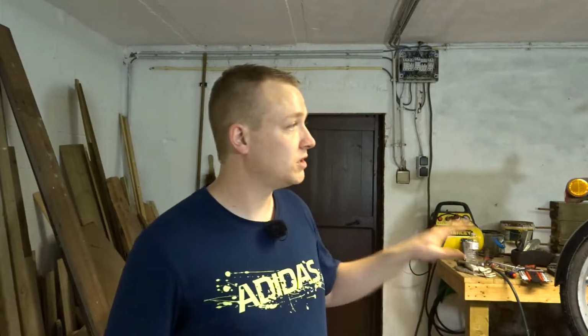I'm gonna have to order some jets. I'm thinking about going as low as 52 or 50 for 10 euro on JMPB parts. This is pretty good. I'm gonna do some small stuff that I don't need to film and then we can start the bike and see how it runs.